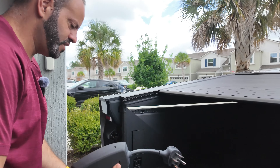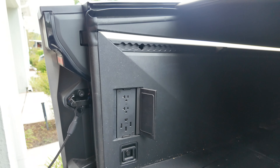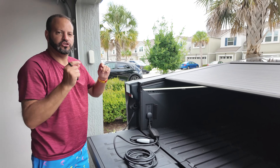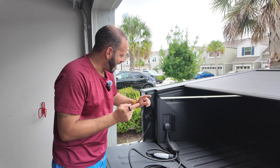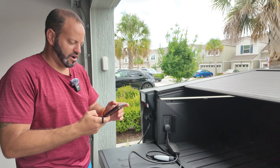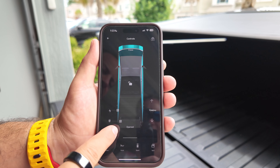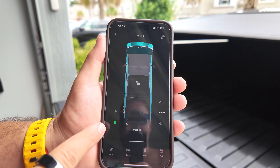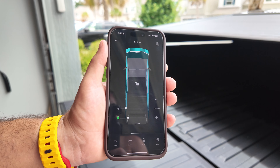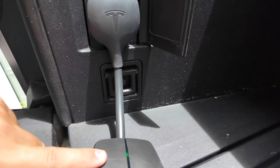Open up your Cybertruck and you'll be able to utilize those wall outlets. Your 14-50 is at the bottom — plug it right in. There is an extra step: you can do this inside the truck or on your phone, and that's to activate the outlets to conserve power, since it is not always on. In the app, click on the outlets and it will power up. By default this will stay on for about 12 hours. You can see on the charger a little green light signaling it is ready to go.